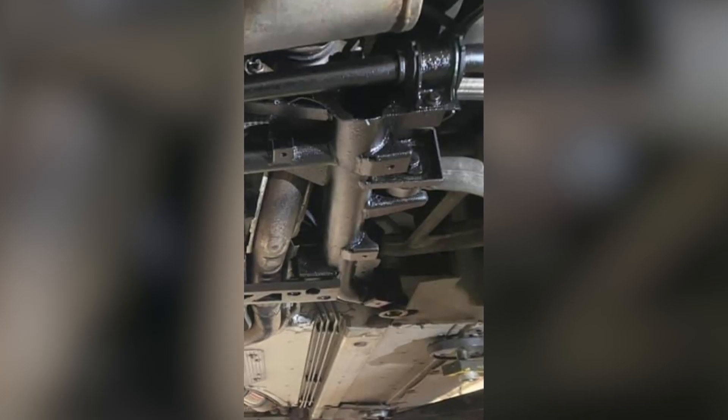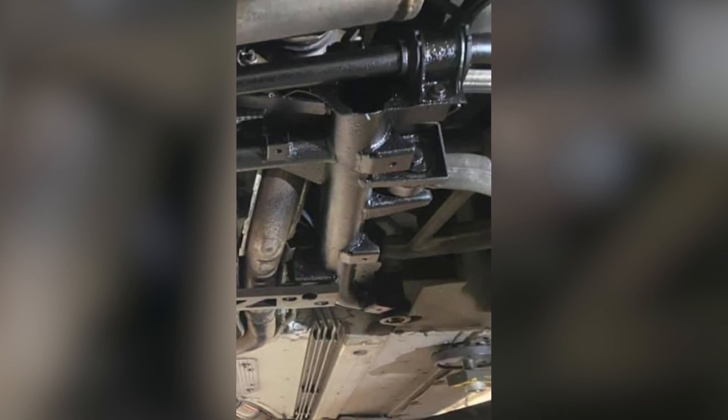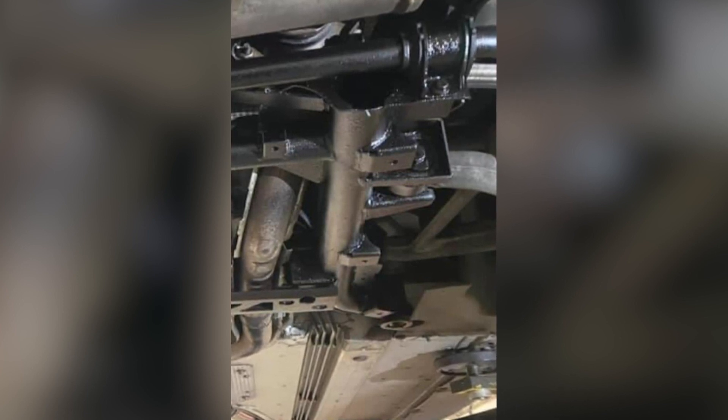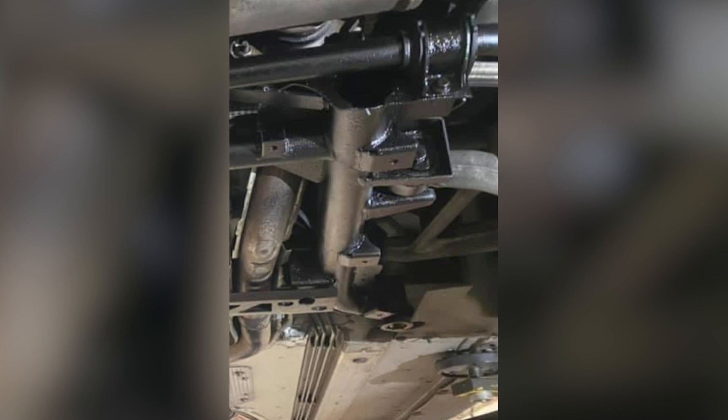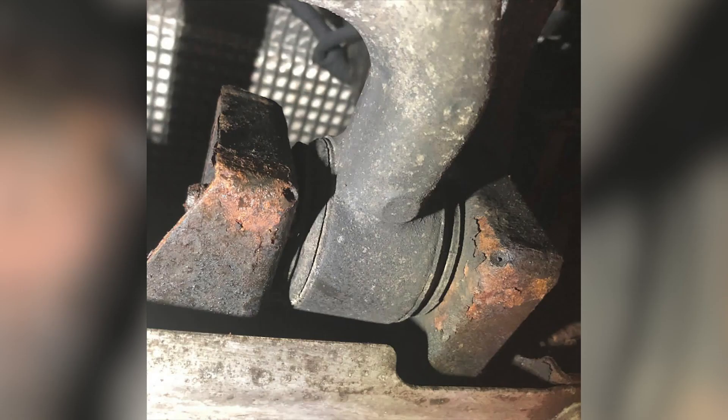In this next picture we can see that whilst it was with the detailers they've done a treatment on the subframe. If you zoom in on areas in that picture you can see there's still some degradation from the corrosion which the treatment has gone over the top of. Looking at where the wishbone arm goes into the brackets on the subframe - this is one treated a year ago - you can already see that in the space of a year the treatment is flaking off and the corrosion is still present.